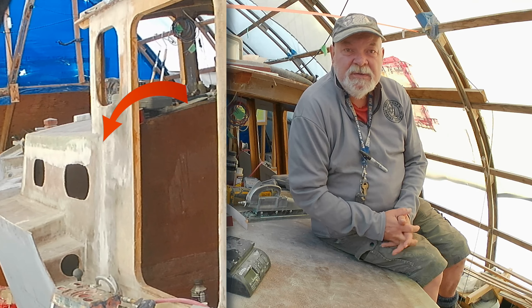In this video, there's some new stuff. I used the 3M Dry Guide Coat to go over the polyester filler because it's all white and you can't see anything. So that helped a lot. Later on in this video, I switched to a System 3 Quick Fair, which is an epoxy product that I really like — it's much nicer to work with and easier. So there's going to be some obligatory sanding and spreading out yet more expensive goop. Without any further fanfare, let's get this party started.